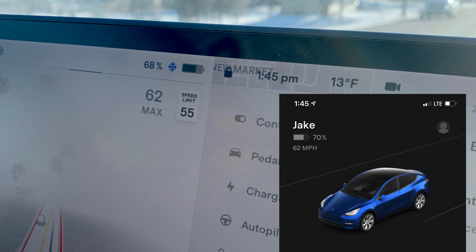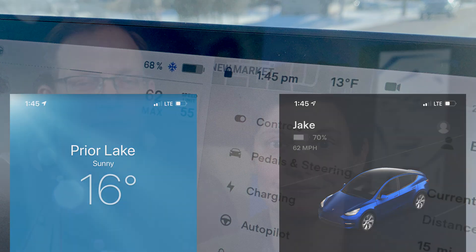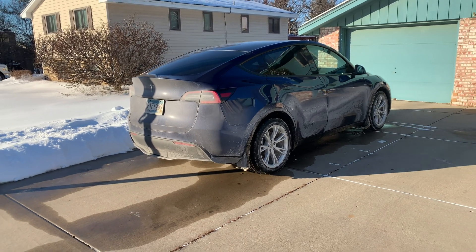For safety's sake, it didn't make sense for me to drive and take the data, so Ellie was kind enough to join me and do that data tracking. Every five minutes, she took a reading on the battery level from the app and from the car, the watt hours per mile, and whether the snowflake icon was still visible. She also added the temperature reading from the weather app. We've already done drive one, we've got that data in, and we're letting the car cool down before we do another drive.